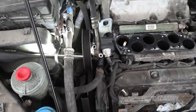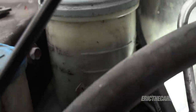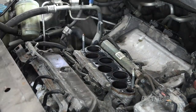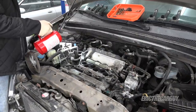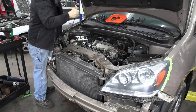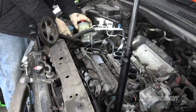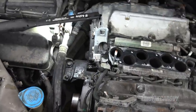I have a new belt. Power steering fluid is leaking out, but I know it was overfilled — and how much do you want to bet it's not Honda fluid? All of that was to remove that fastener so this harness can come up more easily. That gives me the room I want, though this line is going to continually be in the way. If I take this hose off, I can take the whole pump assembly and reservoir out of the way. It's amazing how much doing away with that pump just opens everything up.